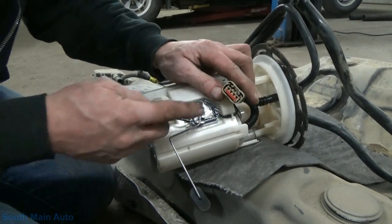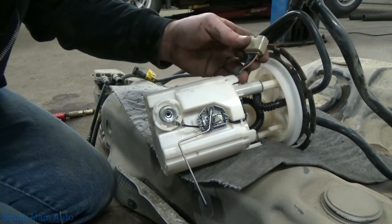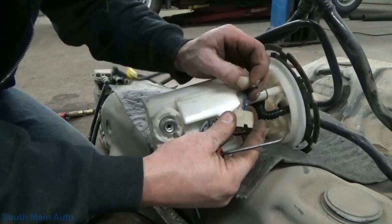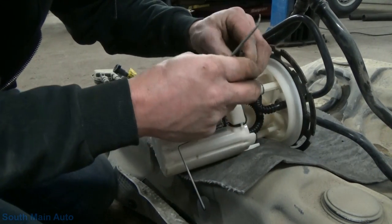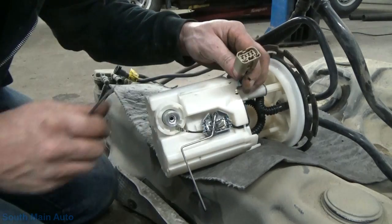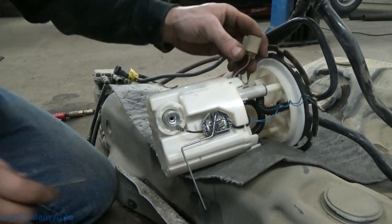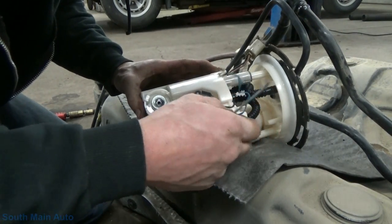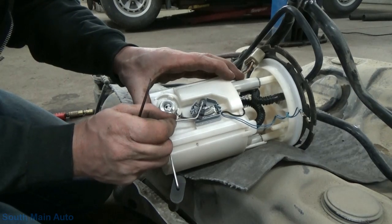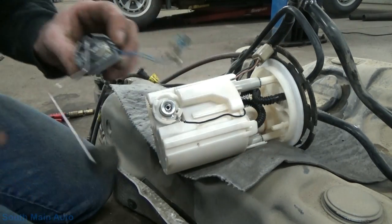And then we've got to dig the red thing out of the connector here. So we'll pull that out. And then we need to remove the two blue wires. I'll hold a little tension on it, reach in there, hit the lock tab. Out comes one. It's all cruddy. Reach in there, hit the lock tab on the other one. Out comes the other one. We're not concerned with which way they go in. We're going to untwist them, fish them around, pull them out of that harness, leave the black wire here attached, remove the lock tab. Whoa, squeaky. Move it down. We'll tear this apart when we're done, but there's our old level sensor.